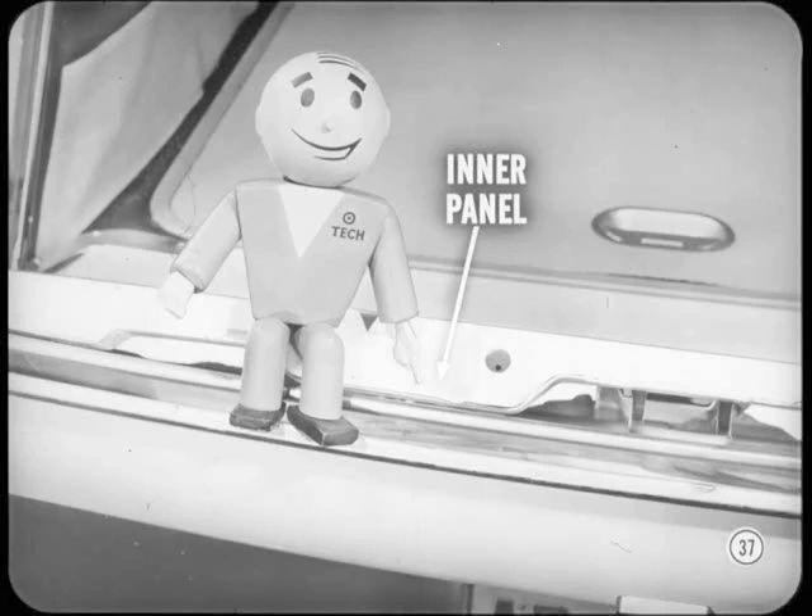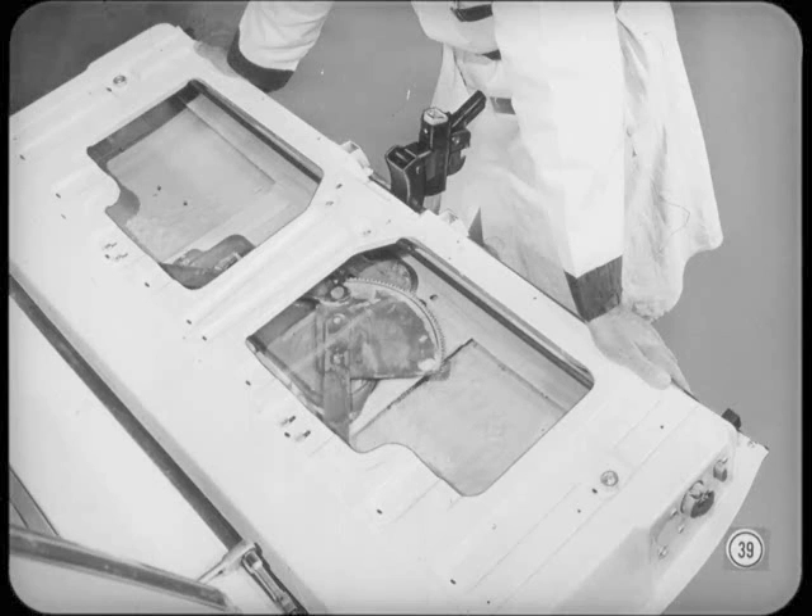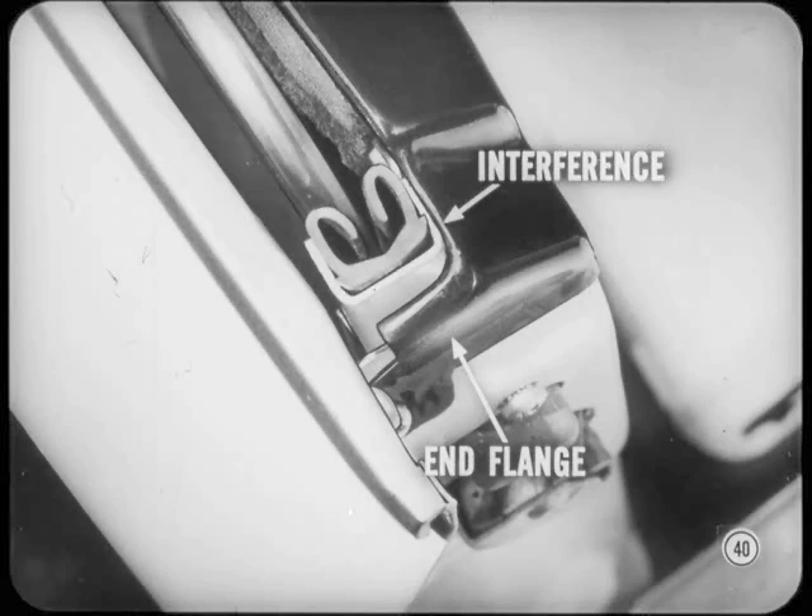In a case like that, open the gate to its wide open position. Use a bumper jack in its highest position so the lifting tongue can slip under the inner panel. With your foot on the jack base so the jack won't slip, press down evenly on the ends of the gate. Bow the inner panel back up until the opening between inner and outer panels is as uniform as possible. A couple of firm shoves ought to do it. Be sure the garnish molding end flange doesn't interfere with the upper end of the run channel — that can put extra drag on the glass.